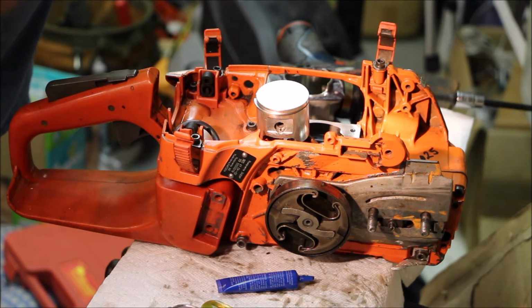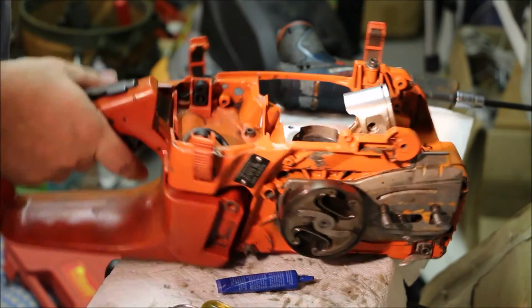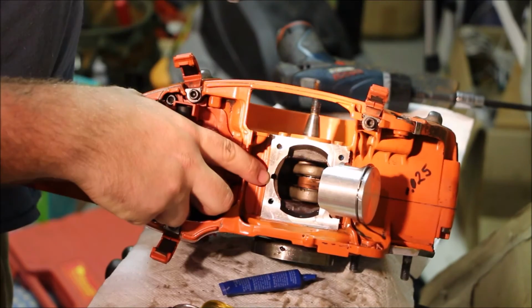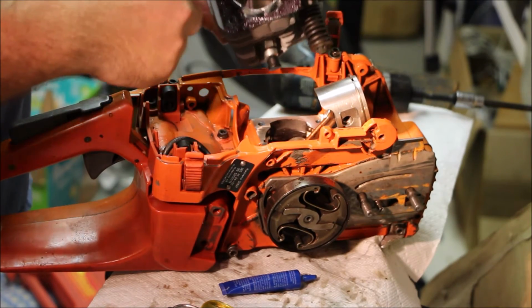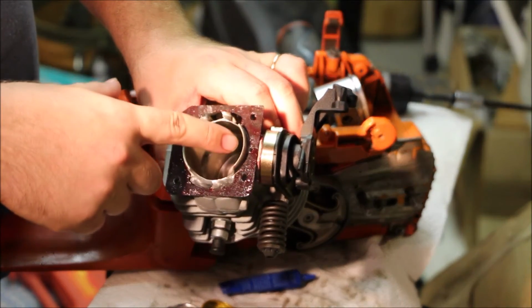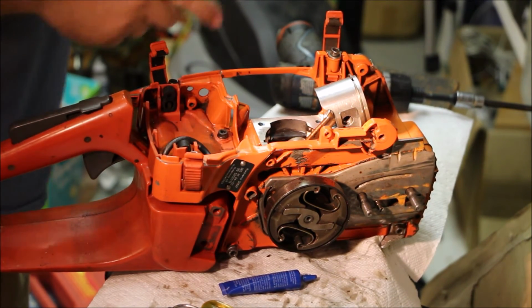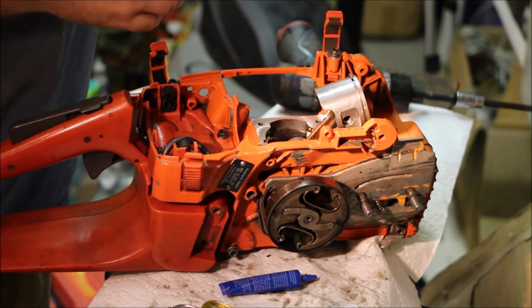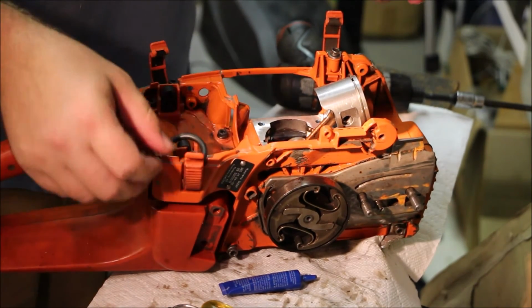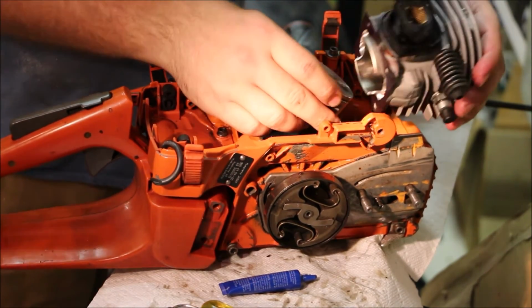So on the 350s, you have to make sure that the impulse tract is clear. And here we know that we've got the good impulse tract here. There's a notch made there, and I know by checking the gasket that it does line up with the hole in the cylinder here, so we will have a good impulse there. So that's good. Our circlips are down. We're gooped up. Our intake is attached. As long as the intake is attached, you're basically good to go. If the intake is not attached, you're not going to get it attached later. It's not happening.